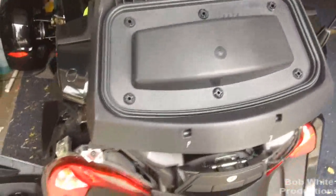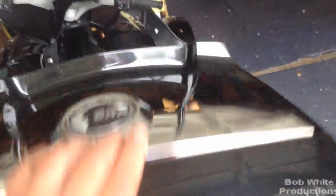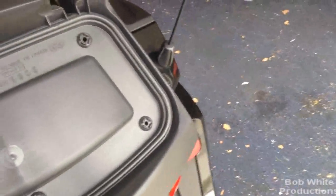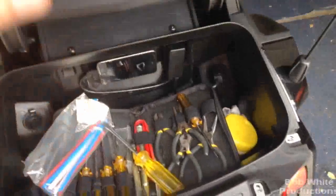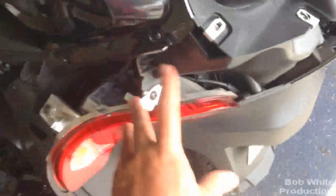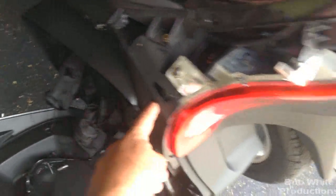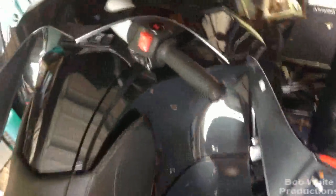Hey spider lovers. So I said I'd show all the procedures I'm doing to get my own Farkle brake light mounted up here. I've removed this panel, and that's pretty simple. Pop your trunk open, and inside there are six screws. Take those out and your Tupperware comes off the trunk. Then we also want to run a wire down and get at the brake lights and tap into them. I needed to remove this panel here - that is two screws on each side, four total. Open the other side bag and there are the same two screws. This panel came off pretty darn easy.